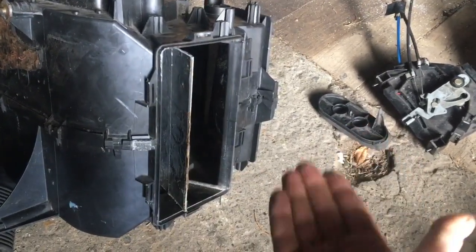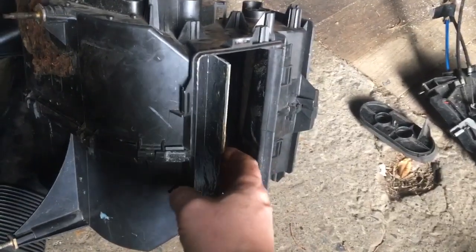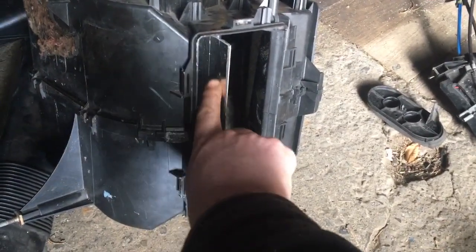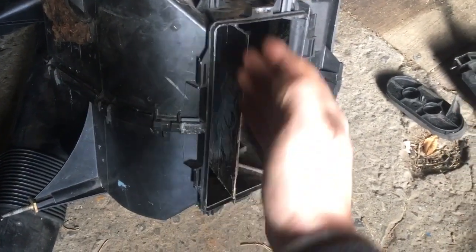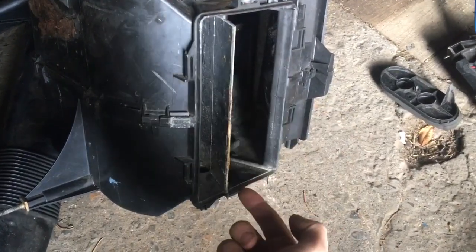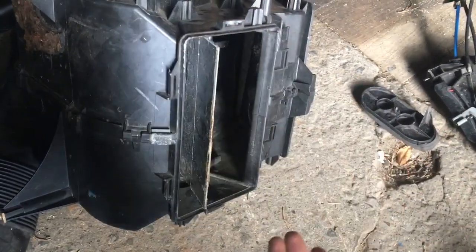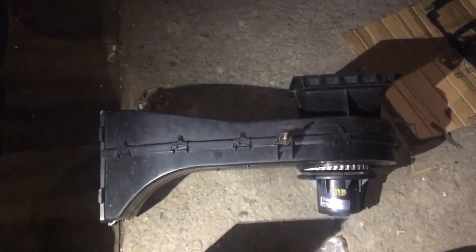The idea is that when you close each of these flaps you're sending hot or cold air to your face, your feet, or the windscreen. I have mine all done now — this is the fix. You put aluminium tape on, and I did both sides. There's no sticky side exposed on one side, so you put a second layer on to make it extra strong. It's aluminium, fairly thin, and I've just blocked up all the holes so my heating system will work.